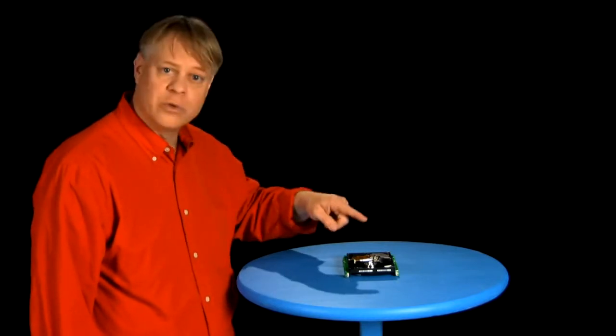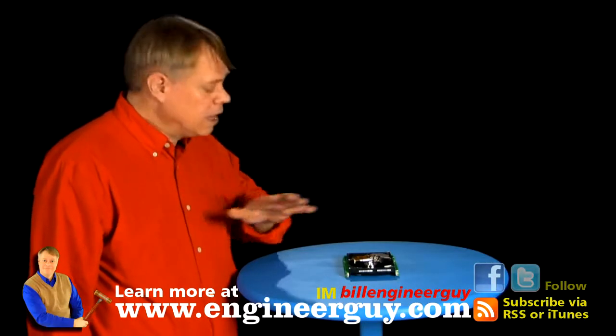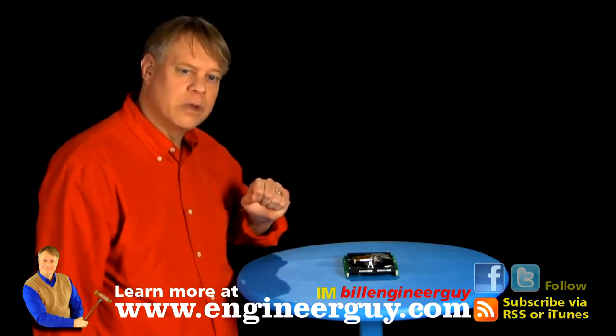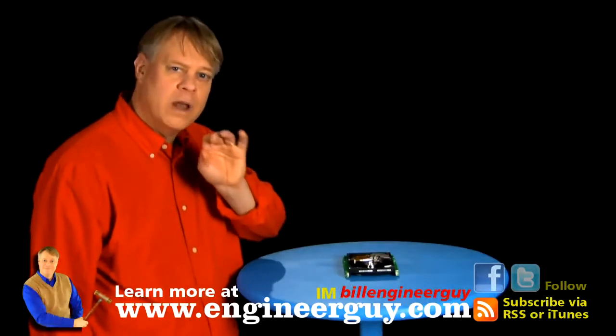Now, because the head is so close to the disk surface, any stray particles could damage the disk, resulting in data loss. So engineers place this recirculating filter in the airflow. It removes small particles scraped off the platter. To keep the head flying at the right height, the platter is made incredibly smooth. Typically, this platter is so smooth that it has a surface roughness of about 1 nanometer.